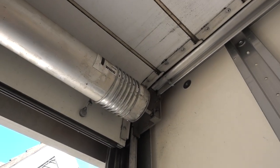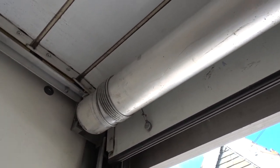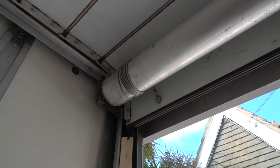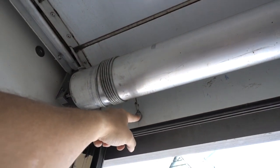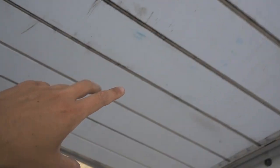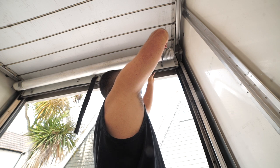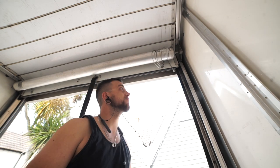So now it's time to pull the old one out and see if the new one fits. I've never taken a roll-up door apart before. I think where I'm going to start is by undoing these cables — one there and one over here. I'm slightly concerned that once I've undone those, those are the only things holding the door up, so I've put some wood in the track here just in case the door tries to slam closed on me. Also this drum here is under tension with a spring inside it, so once I undo these, the cable is potentially going to spring back. Once all that's undone I'm hoping the door itself will be free and I can undo these rubber end stops and slide the whole door out of the tracks. I thought that might happen, but it's not as bad as I thought it was going to be.